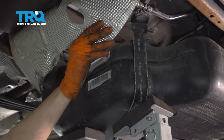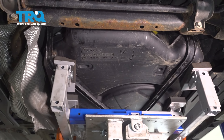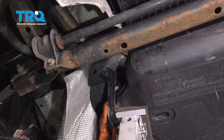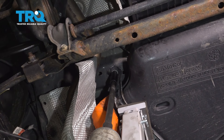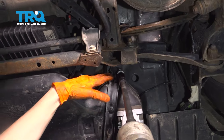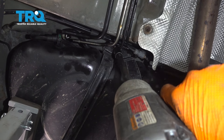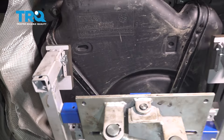Keep raising this up — make sure it doesn't get caught on the heat shield or pinch any other lines. Everything's lined up. I'm going to bring it up all the way until all the strap mounting holes line up. The front lines up — let's check the back. The back is a little bit off, but we can fix that. Bring the bolts up and start them in. I want to get all of them started and position the fuel tank where it needs to be before tightening. Get the front one in, and now that they're all in, snug them all up. Now we can take our support off and the tank will stay in place.